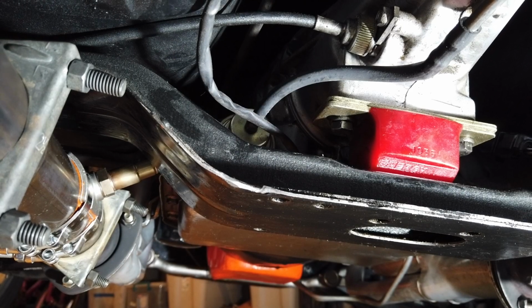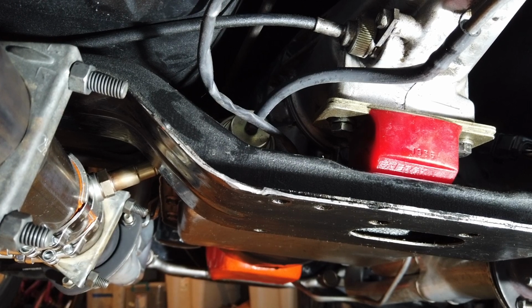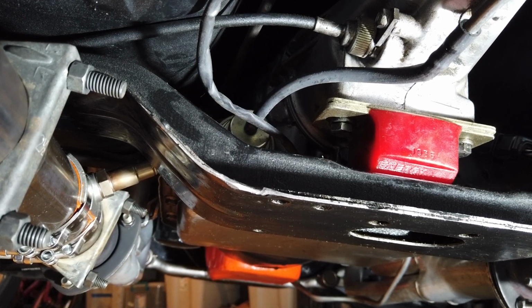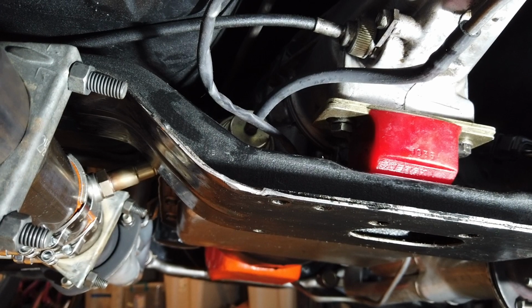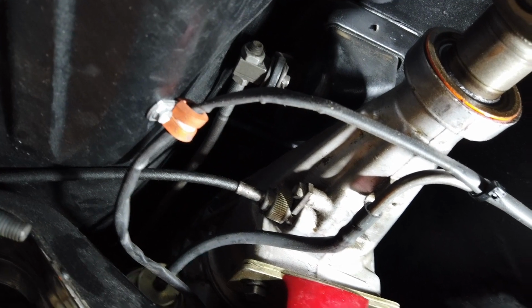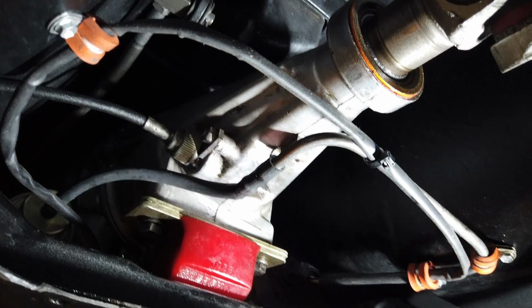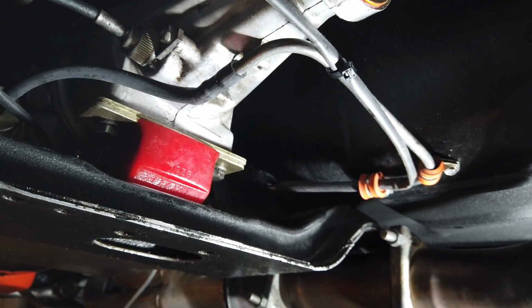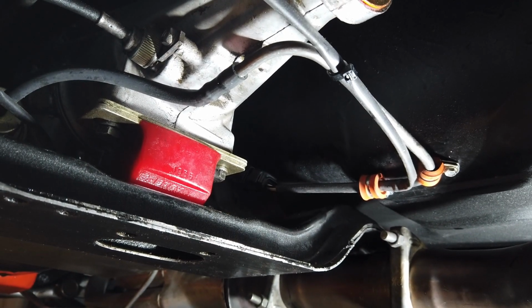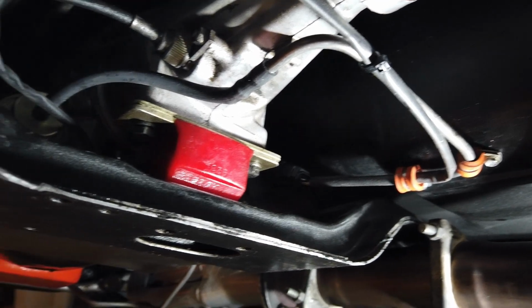And that's it. We're finally done. The O2 temporary bung is in place. The O2 sensor is now installed with a 7/8 inch wrench. So you can see how the wiring from it comes up and around, and I use an Adel clamp, and then I have it zip tied over to one of the vacuum lines that goes to my 2-speed Powerglide, around the corner to more Adel clamps, and then it finally attaches to the other mating end.